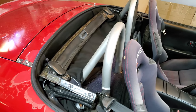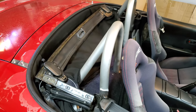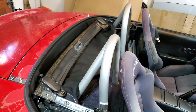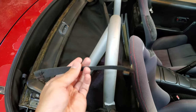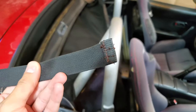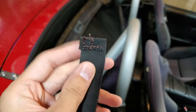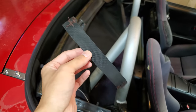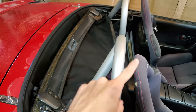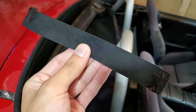It's another day, another weekend — time to get back to this convertible top. Previously, the glass support straps going across bows three and four had one that was much shorter than the other. What I ended up doing was taking some of the old glass support strap, cutting it, and sewing the ends so we have a new strap. I just have to burn or drill holes through it for the rivets. This now should match the length of the longer of the two pieces, so I don't have trouble with the bow gap based on the non-flexible textile piece maxing out.